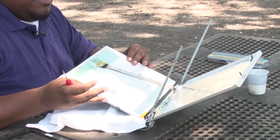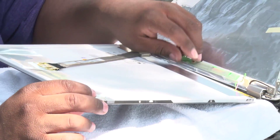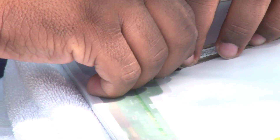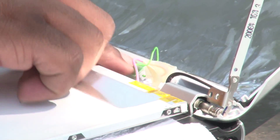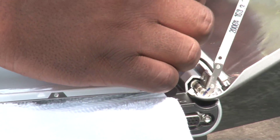At this point, your screen will now come down. On the back of your laptop, you will have either one or two cords. This one, being an LCD, has a video connector and an inverter. The first thing we will do is remove the tape from the video connector. After the tape is removed, we will move the video connector with a simple pull at the bottom. For LCDs, we have inverters — the green circuit board you see separated from the screen. Grab the end with the wires connected to your laptop and simply pull the white part out with a simple tug.